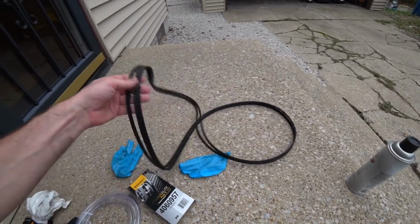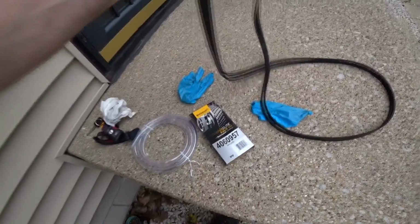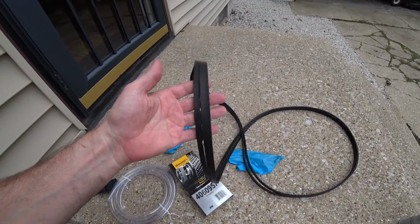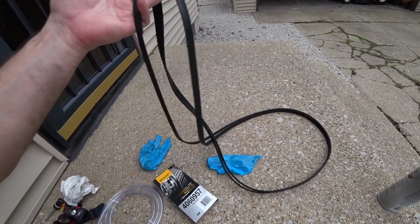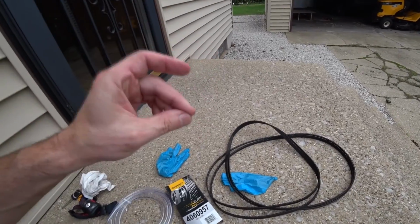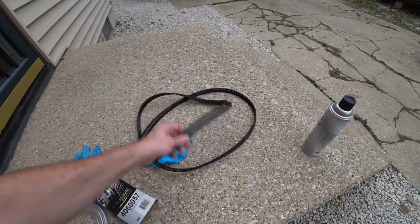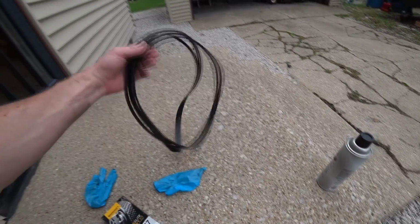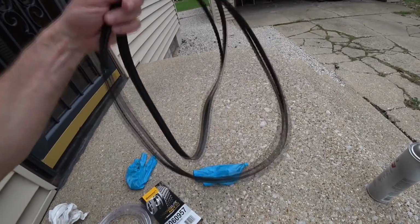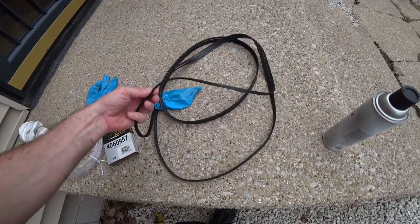I take the belts off, check every bearing, every pulley. I carry spare belts with me anyways. Look what I found. Shredded belt. Basically it was a tiny little rock, white rock stuck in the groove of the tensioner pulley. And this belt was only like 10-20,000 miles on it. I can't remember when I replaced it, but not long ago. And it just shredded the whole belt.